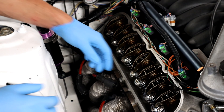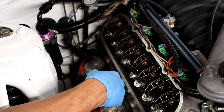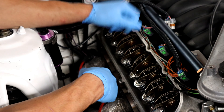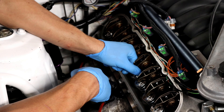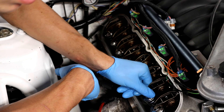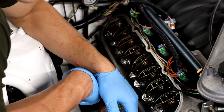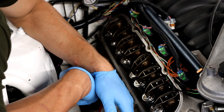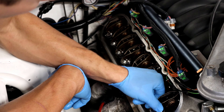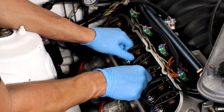All right, let's see if they're loose. I've had an issue with the very last rocker arm on the driver side that keeps coming loose, and I don't know why. Everything feels great but I guarantee that back left one is going to be loose, because you can hear it coming through the firewall when you're driving, and it develops after about a whole day of driving. I don't know if the bolt is stretched or if the threads are messed up — the threads look fine — but it just keeps coming loose. I don't want to torque it down any harder because it is an aluminum head, so we will check the other side and see if we have any problems and hopefully figure out a new solution.